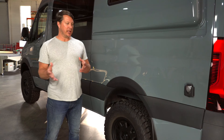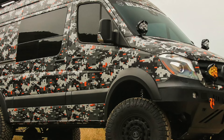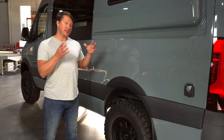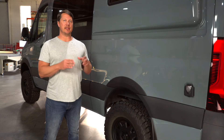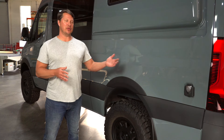If you're trying to get the biggest wheels and tires on the van you'll most likely need to lift it a couple of inches to make room. These upgrades aren't as simple as buying new rims and tires and telling the tire shop to put them on. Most tire shops not tuned into Sprinters will tell you the new wheels and tires don't fit — their computer will say there'll be rubbing. Those of us into Sprinters have workarounds, but just be aware that not every tire shop will know what to do with a Sprinter.